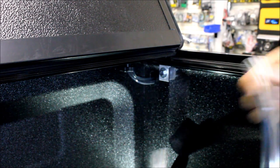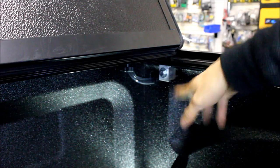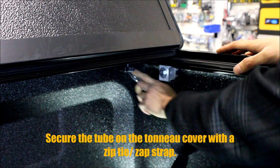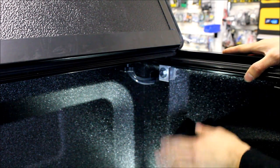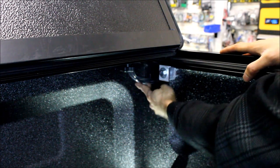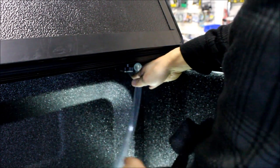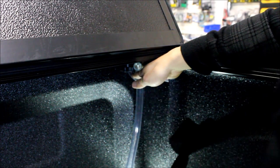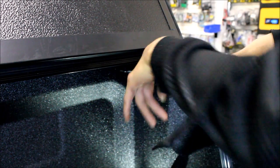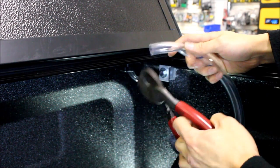Now you're going to install the draining system. All it is is a tube that comes with the tonneau cover — it just slips on and you can place it wherever you want. I decided, because I had enough of a drop, to run the drain port right into where the stake pockets go. Since Allman's never going to use the stake pockets and they still have covers on them, we put the drain in there for a clean look — that way nothing in the bed will slam into the tube. There are grommets down low on the side as other options, or you can drill a hole in the bed. When cutting the tube, use a proper cutting tool to get a nice clean cut.